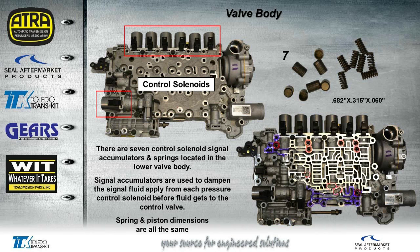Once we get the valve body off, the first thing you're going to take off is what they call the control solenoids plate — we're going to take that channel plate off first. As soon as you do, you'll see seven accumulators. Now, these seven accumulators and springs are accumulated to dampen the signal fluid from each of the pressure control solenoids — they want to smooth that oil signal off before it actually gets to the control valves. All the springs and pistons are exactly the same size, so you don't have to worry about mixing them up. What I did like about this design: we've seen in the ZF units, the accumulator is very similar, and they use a rubber ball on the bottom as a cushion — those have a tendency to flatten out over time, causing shift concerns. I don't see these springs wearing out any time too soon — they're pretty healthy springs.